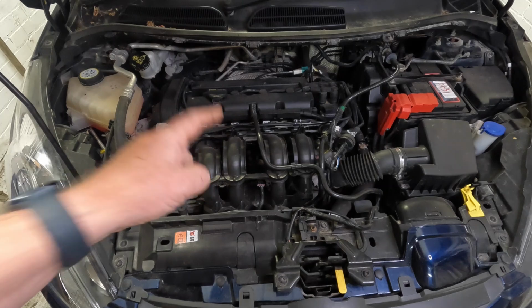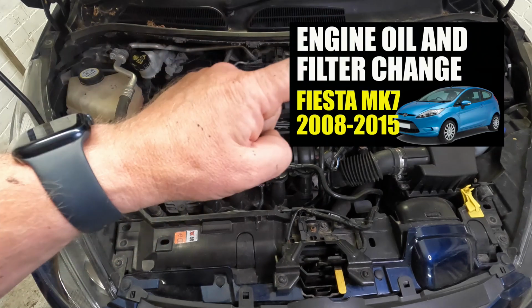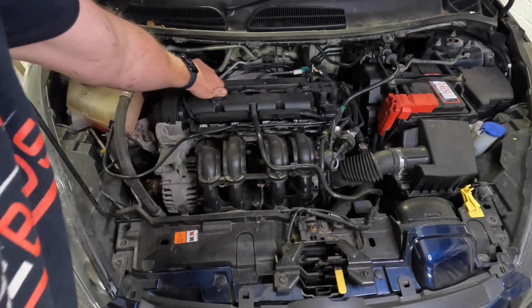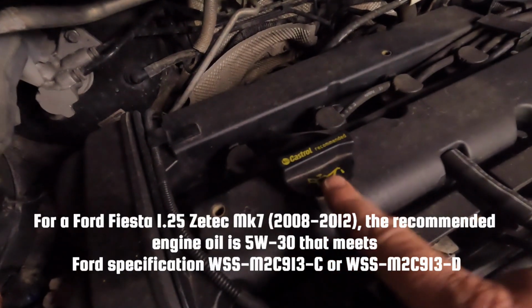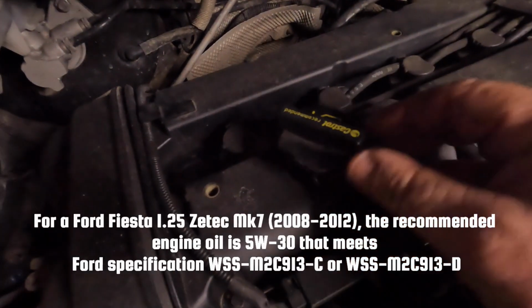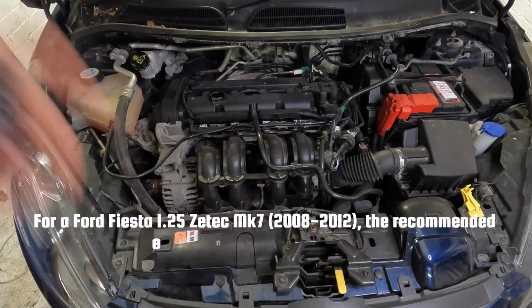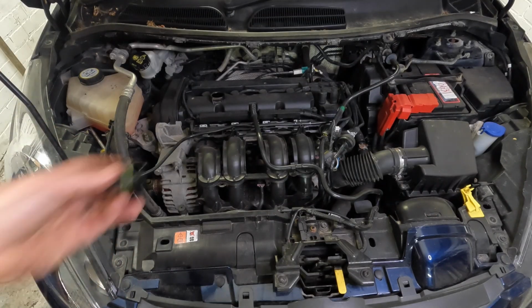Now the engine oil on the car I have covered in a video on the channel, which I will leave a link to above, but what we would do is we would add the correct grade oil through this oil filler right here on the top of the rocker cover, and then fill the oil level up to the right level, a small bit at a time, checking on the dipstick to ensure it's filtered through as part of that change, and then we should be good to go.